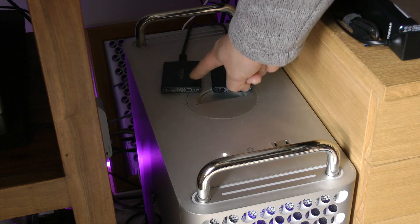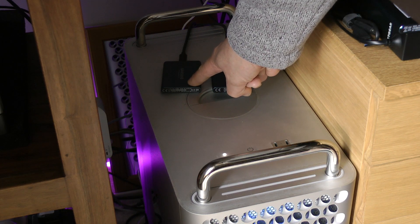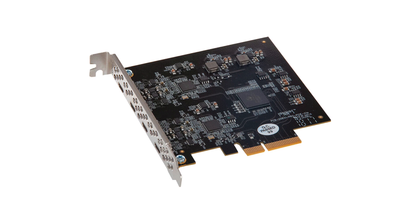I connected this card to two Samsung T5 SSDs, and it's because of this card that I bought the OWC 4-port hub — this card has been replaced once already, and the current one has been having problems mounting the T5 drives on Mac Pro restart. This problem got worse when Big Sur was installed. I don't quite understand the connection between the two, and I did not get an answer when I contacted AppleCare. They said give it a few days and call back if you still have problems — which in my head translated to: we don't know and we cannot help.